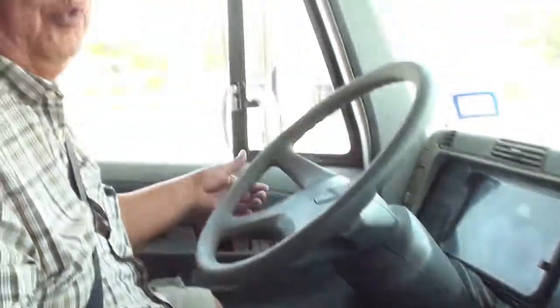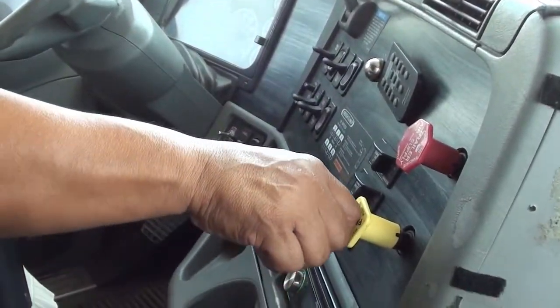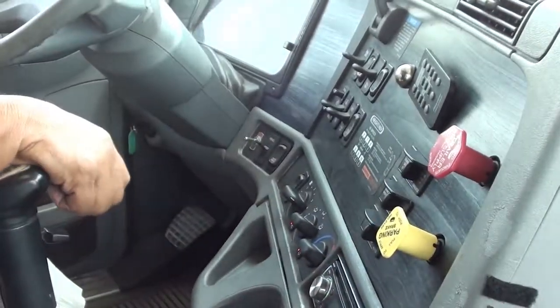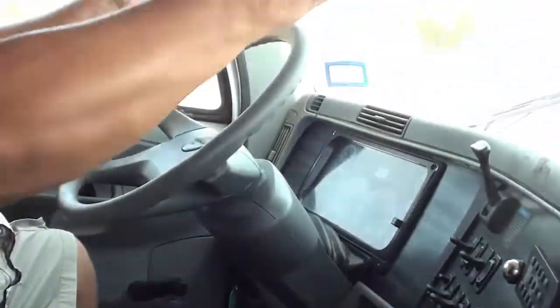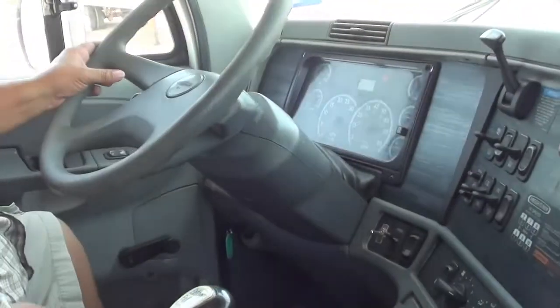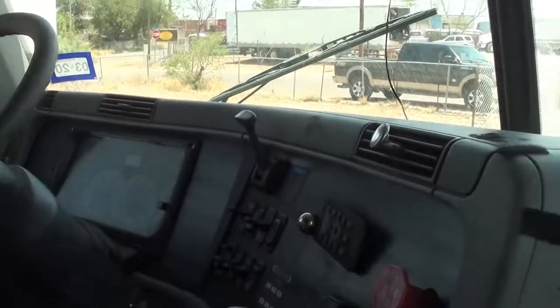The first step, we're checking for leaks on the tractor and the trailer. So I'm gonna push my yellow button and my trailer buttons. We need to let the air settle down, because remember, right now, when we push the button, we're supplying air to the whole truck, so the gauges are gonna move. When the gauges are settled, you're gonna tell the examiner that you're gonna wait 1 minute, and you should not lose 3 PSI with the trailer brakes and the parking brakes.